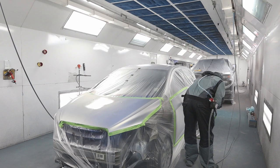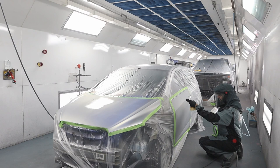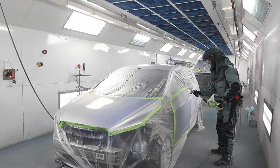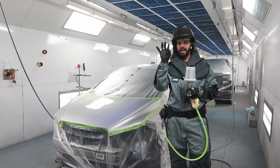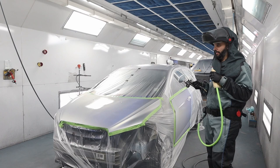Just one coat on the entire panel at the beginning. Your metallics will land in something wet when you start blending and they won't be standing up. I know it's got a kind of weird hue at the moment but it dries clear — it's not going to change the color of your blend. I don't necessarily go to the very edge because I'm going to have new paint there, so I kind of stop right before it. That's where I'm going to start my blend.